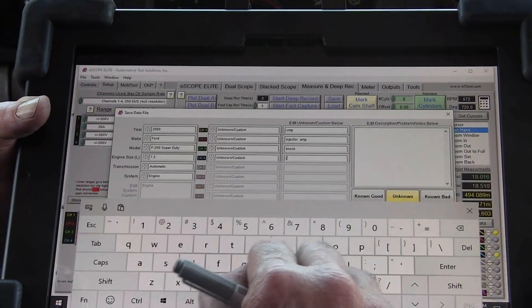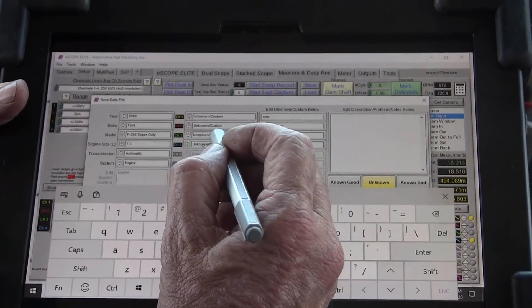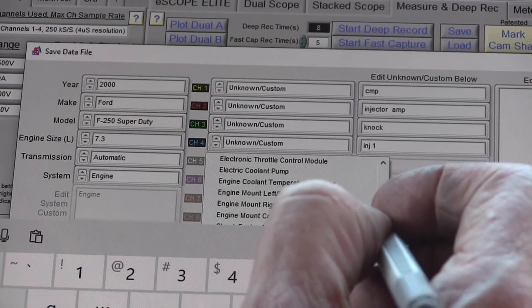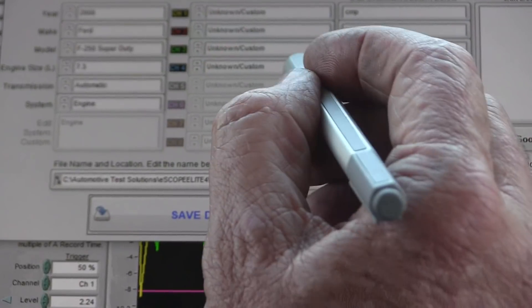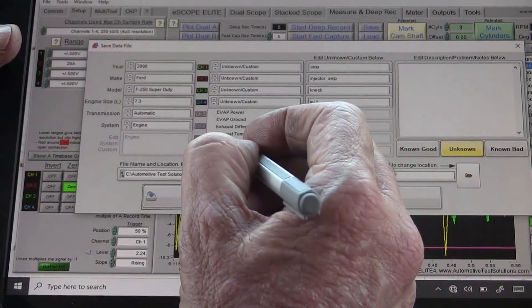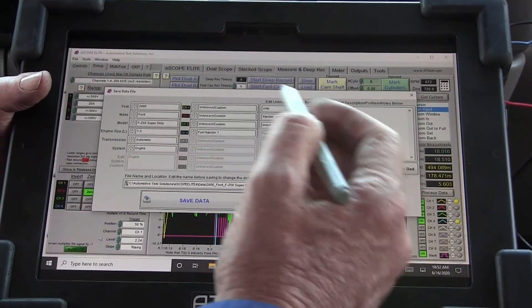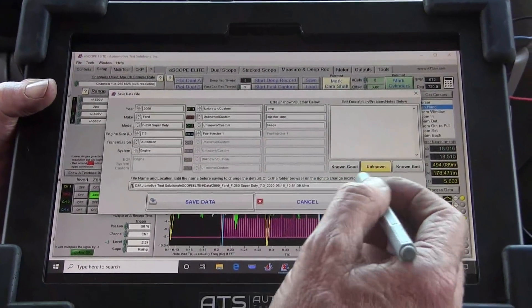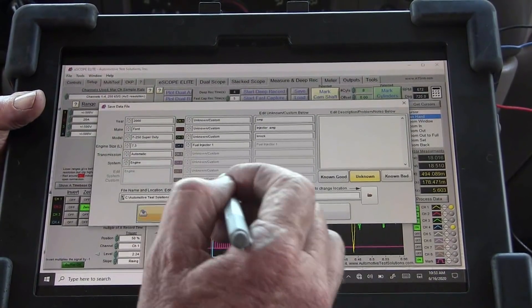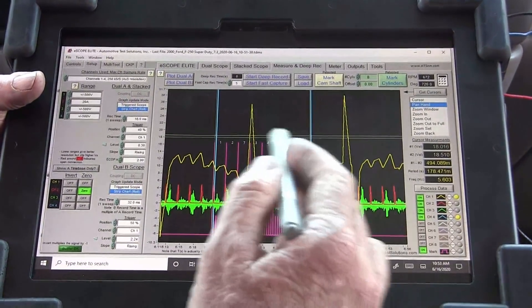And this is injector one. Now the other way I can do this, if I don't want to type them out, I can actually go in and look at these and find what we're looking for — fuel injector number one. So that's all marked in there too, whichever way. This is an unknown waveform right now because I'm not sure what's going on. Right now what we see is good, but we'll leave that as unknown — we could put known good, unknown, or bad. Right now it's unknown. We're going to go ahead and save that data so we could recall it if we need to go back and look at it. It's always good to save your data.